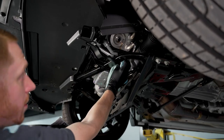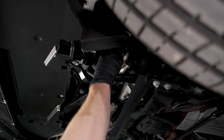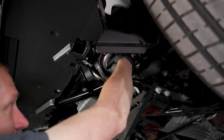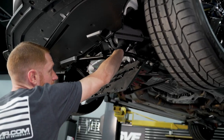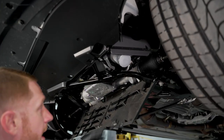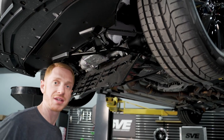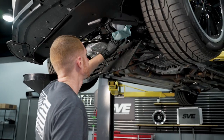Now we're ready to install it. You may get a little oil run back — just wipe it up. Don't cross-thread it. Spin it on until it gets firm with your hand. The Ford book calls for 142 pound-inch, but I always just hand-tighten these — basically when it makes contact with the oil cooler I just go a little further and call it quits. Then double-check you didn't get a bunch of oil everywhere, because oil attracts dust and crud.